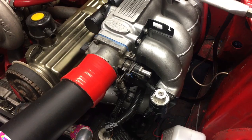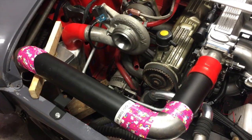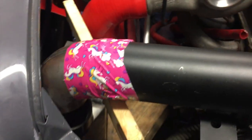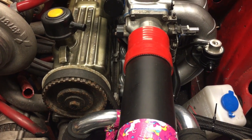The charge pipe - yeah, it's complete overkill but it's awesome. It's made out of three-inch exhaust pipe, mainly because I've got some, but also because the outlet of the charge cooler is three-inch. It's just a small section to go between that bend and the silicon joiner, into a 90, then a nice straight section across the front of the bay, into another 90 and down into the throttle body. The question now is: will the bonnet fit?